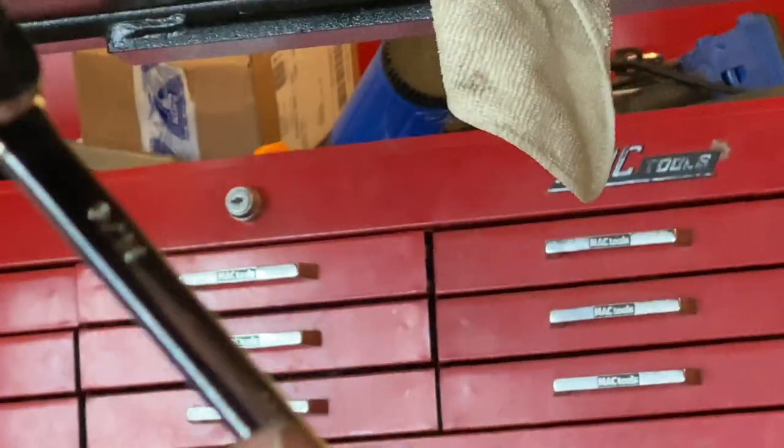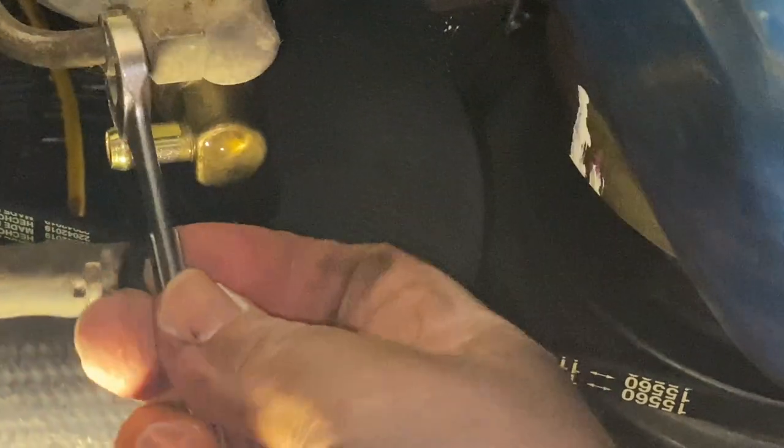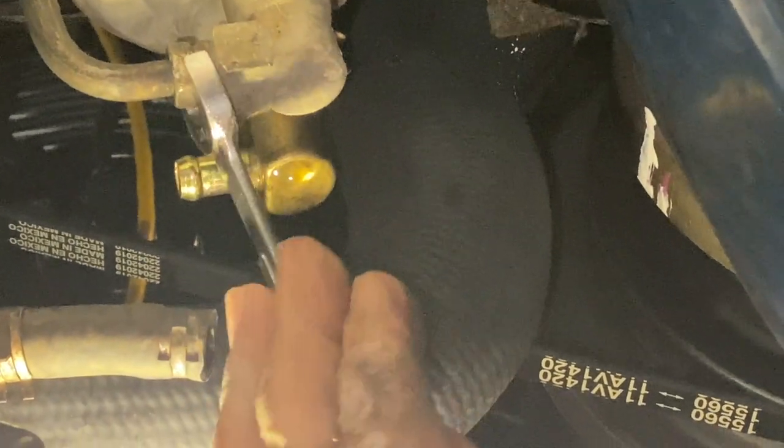Which means as soon as I buy it I'll find the old one. For the fuel pump hex I'm going to use a 9/16 open-end. The idea is you get this on the fuel pump housing nut so that it holds it in place, so as I turn the flare nut it will rotate without putting stress on the fuel pump. We don't want that — we want all the stress to be between these two wrenches.